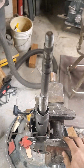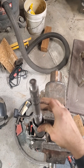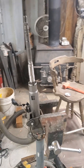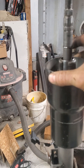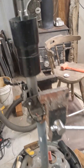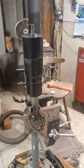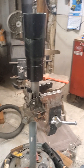There's a little bit of runout - I'd say about a 16th of an inch. I don't know if you can even see it with me spinning it, but I'd say there's a 16th of an inch of runout. For a steering column, I think it'll be fine when I have the bits and pieces back together on top of it. It appears to be pretty good, it doesn't rub, and I'm pretty happy with it overall. I think it'll work fine, assuming I can figure out how to put the turn signal, ignition cylinder, and all that stuff in. The overall length and these mounting tabs I think are going to work out pretty awesome.